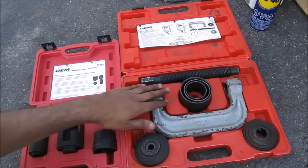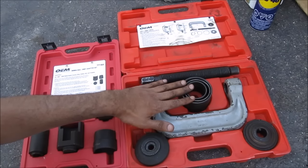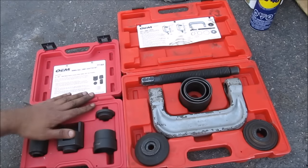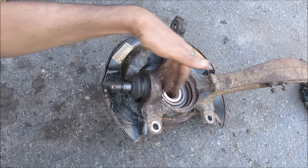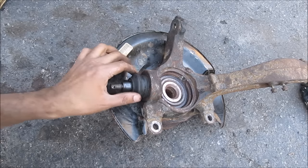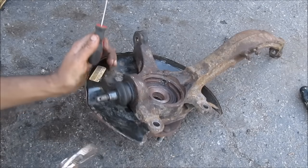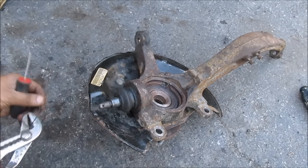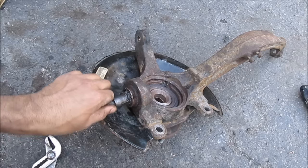To press out the ball joint I'm going to be using this ball joint press — it's basically a giant C-clamp with a bunch of adapters that adapt to the size of the knuckle and the ball joint. These are the Honda-specific adapters. The ball joint is pressed in from the top and goes downward, so we're going to need to press it out this way. First I'm going to remove this boot so we have a place to press onto — once that ring is removed, remove the boot like that.